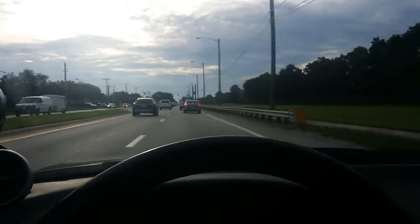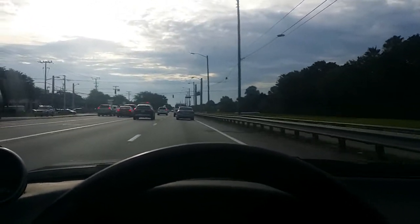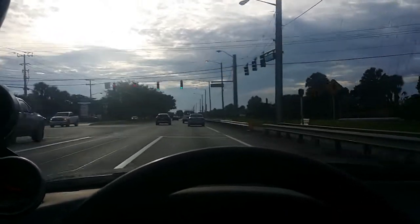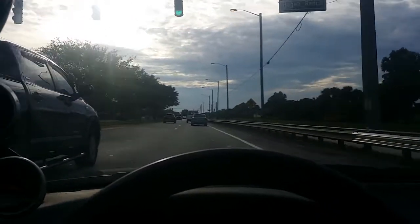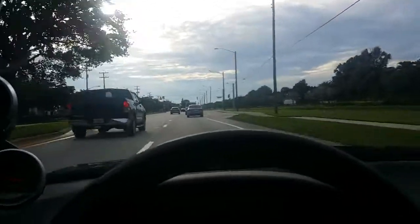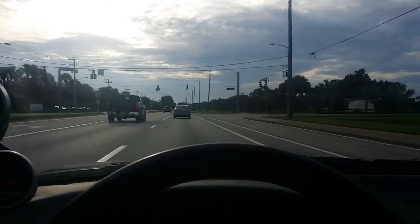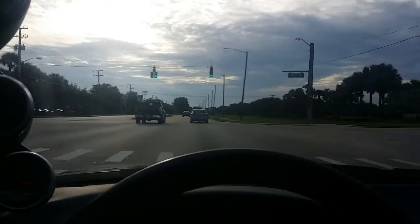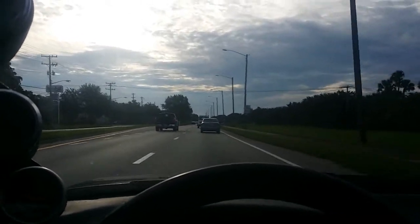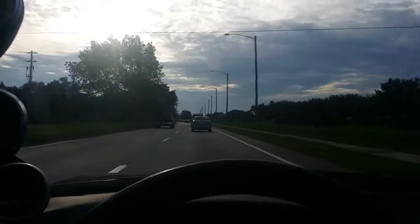I did a little pull, got to 34 pounds — it had actually pretty decent AFRs, better than expected. It didn't cut out, didn't blow out. She felt good. Hopefully I can get it to stay like this, or at least get the closed loop enabled like I said.